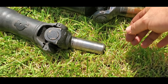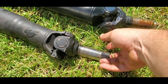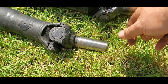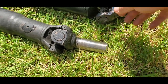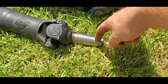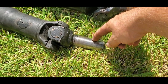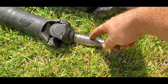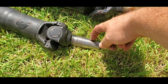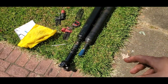Apparently the shaft from a hydraulic cylinder circa 2006 is the perfect diameter for the inside of a yoke. It fits in there — it was a machinist fit. It slid in there, you just hear the air coming out of the splines, so it is a very very tight fit. I can't get it out of there, which I kind of need to do — maybe remove like a half inch. I think it was two and a half inches; I probably should have put two inch. It's going to be kind of trial and error honestly.